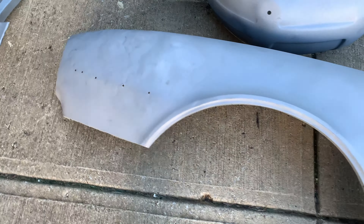Now the subframe — the front frame of the car — looks really nice. There were no surprises except for this area here that looked really rusty. I said check these out carefully on your cars. Check that out — there's a hole right there. So we're going to have to do some repairs here. I was kind of wondering, said wait and see what happens when you get it back from the blaster — well this is going to need some attention. As for the rest of it, looks real good, no severe pitting. I think we just got to fab a piece back here and repair that.